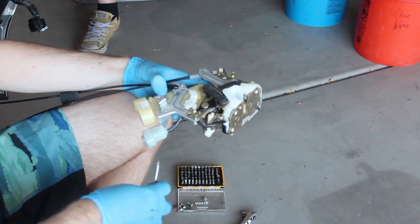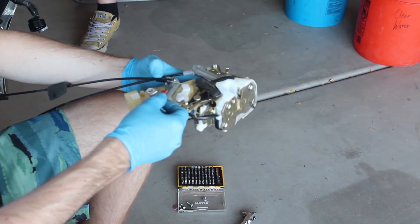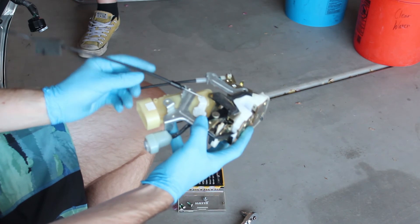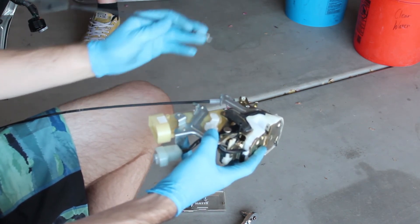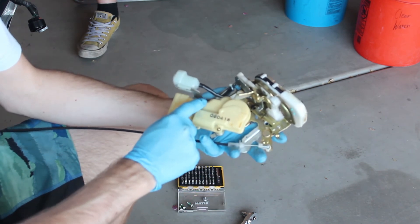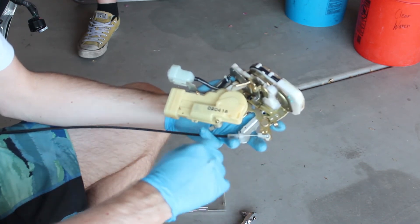I just popped this cable out of its slot. Basically what I needed to do is take a screwdriver, pop it under here, and while pulling up on this with my finger, pry up with the screwdriver to get it out of that slot. To get the cable out, you lift the cable up and pull it out — it's kind of an S or L shaped cable. Once you've pulled it out, all you need to do is pull out these two screws, pull off the old broken actuator, and put the new one in — it's a straight swap.